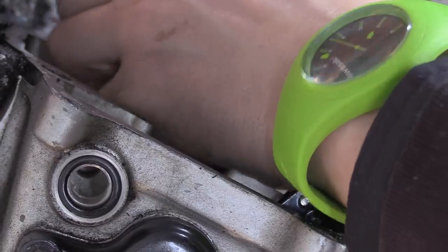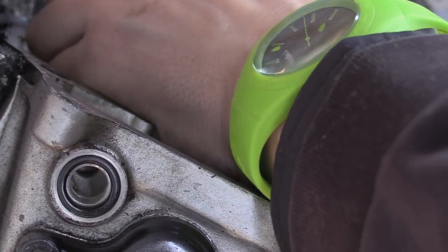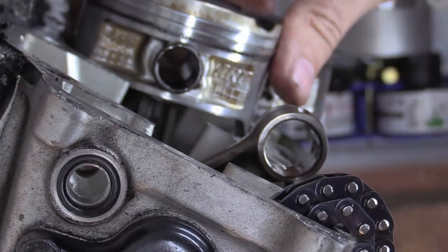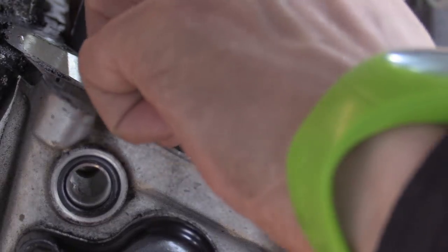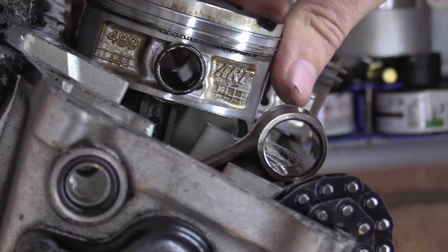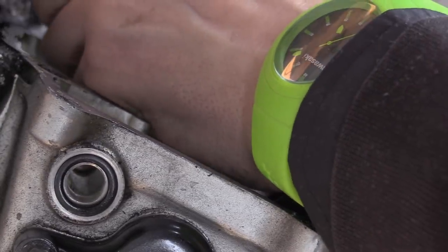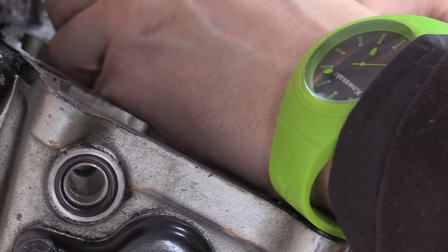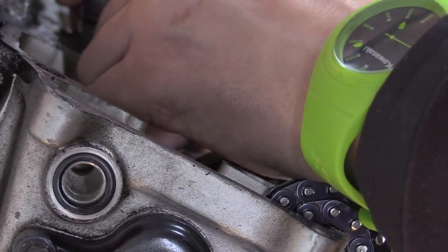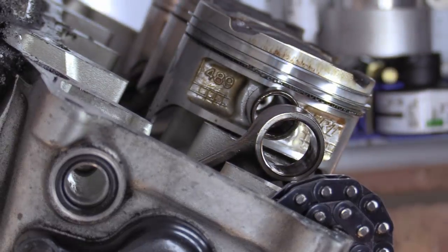This piston's going to be a problem — I can't get my finger in. Rule number one: do not grab this with anything and do not stick a screwdriver in there. I've seen all sorts. If you need to knock them out, you can get a socket that will fit in there — just make sure it is the right size — but obviously you've got to be careful because the pins are on the other side.